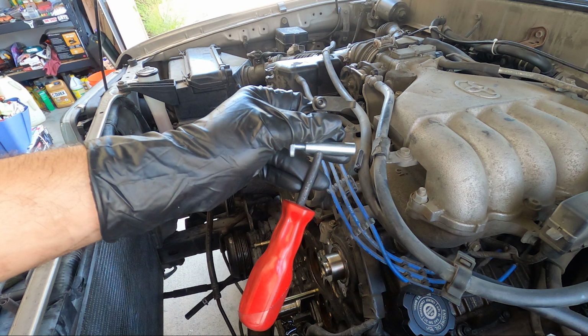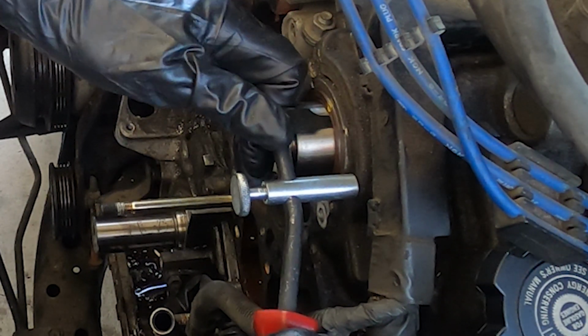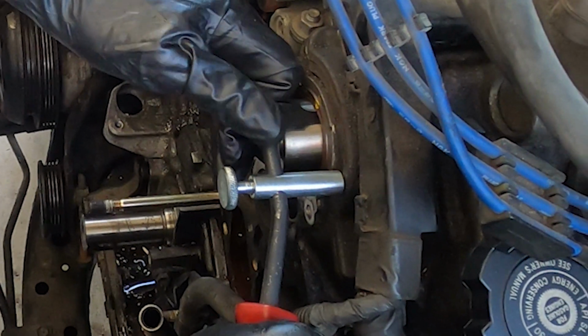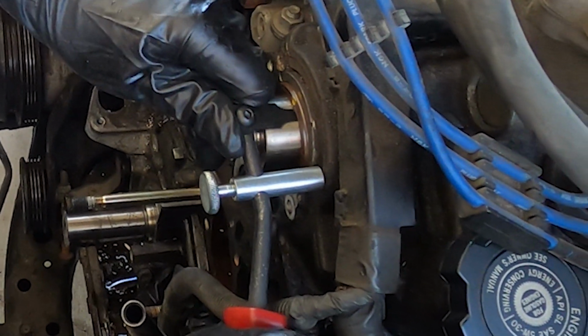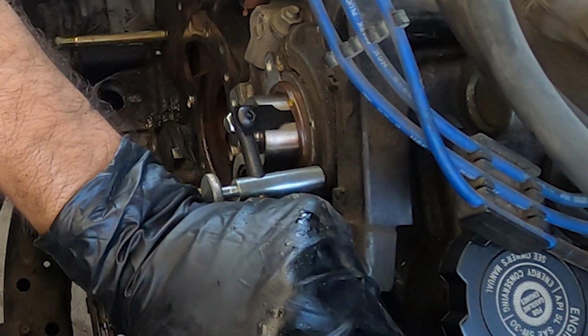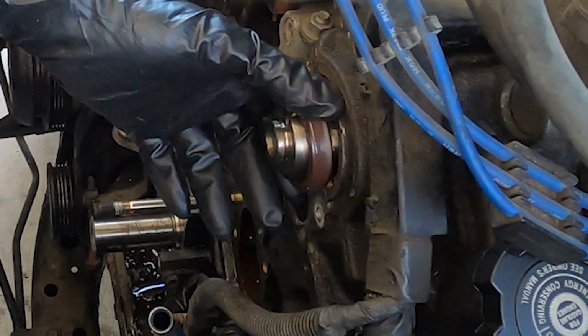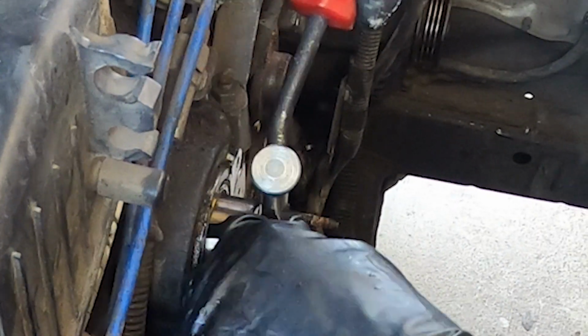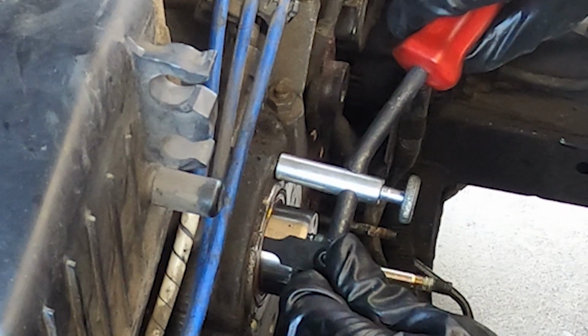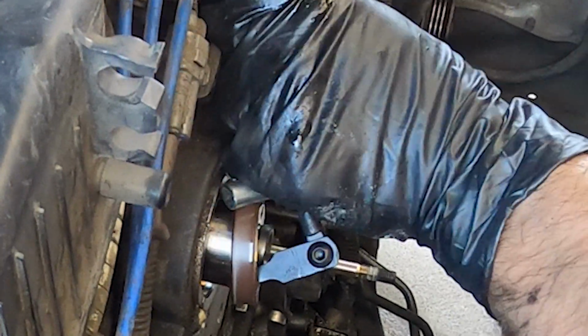Screenshot of the seal pulling tool that I'll link in the description below. This tool is absolutely vital in you getting the cam seals and crank seals out. Takes just a little bit of effort to slide the tool underneath the seal, and then you use the leverage of the arm in order to pop the seal out. You can see a nice little bump here, tap, tap, tap, and it comes right out. Doing the same thing now just on the passenger side cam seal, and you can see just how quick this thing is at pulling the seals out.